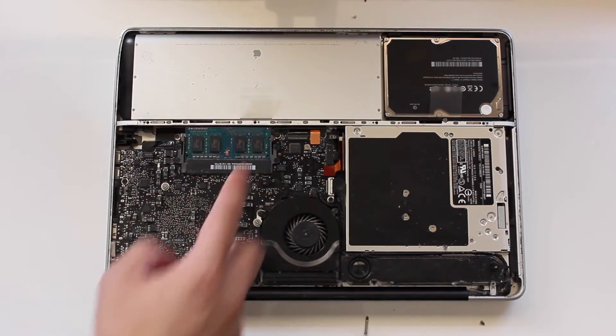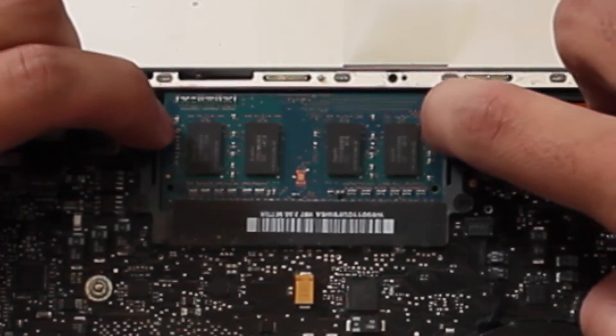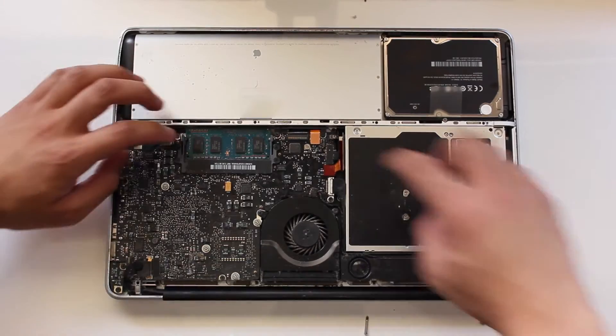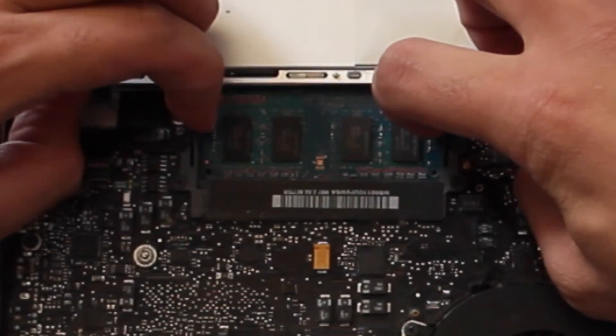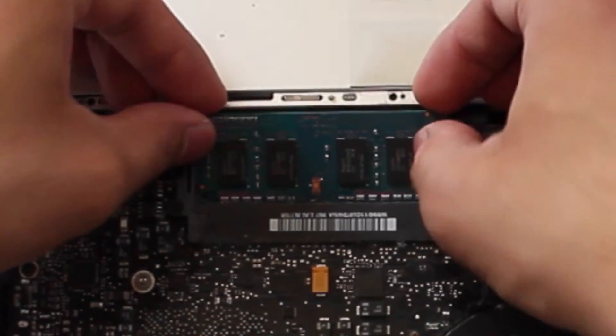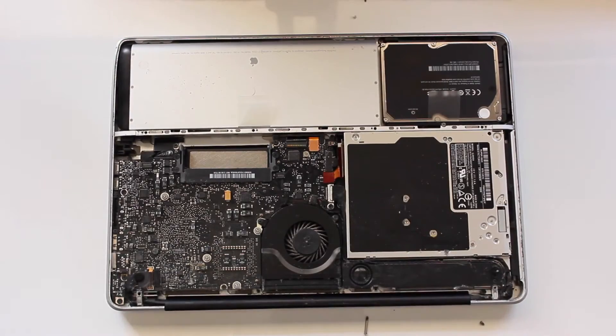This green chip left of center is our RAM. To take it out, there should be two prongs on the sides — very slightly pull them apart and the RAM should just pop right out. Do the same thing with the bottom piece, pulling apart those two prongs and the RAM should pop right out. The bottom piece is always more difficult than the first, so be careful when pulling them out and not to break or touch anything.